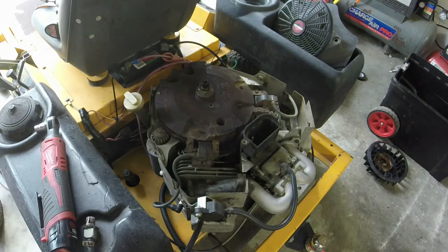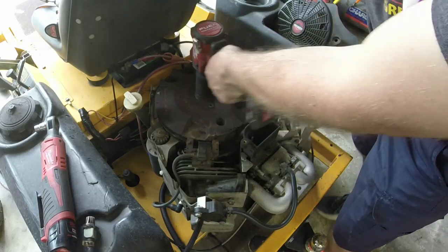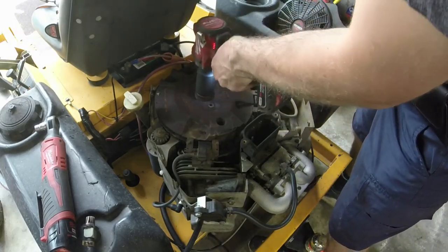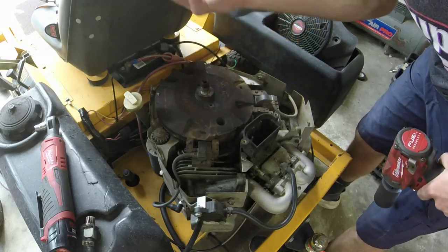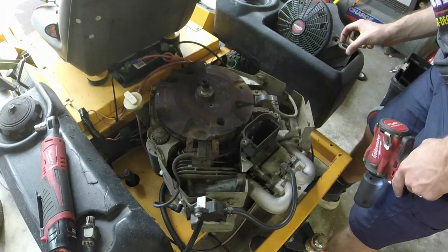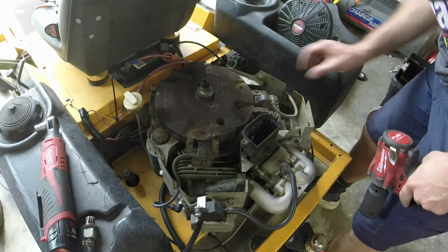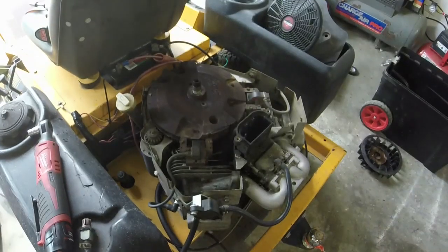It is a 32 millimeter, and an impact is your best friend when it comes to this. There is a washer on this one too. Flywheel key looks good. That's a good thing. And we got some corrosion and stuff, so it may be seized on. Hopefully not too bad, but I'll throw a little lubricant